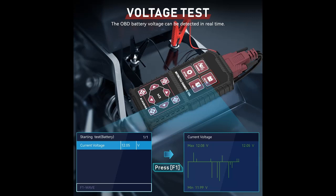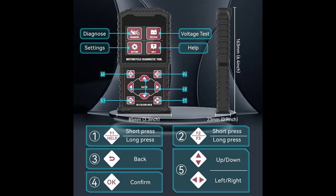Software Upgrade. Connect the device to the computer and wait for the device to be recognized. After recognition is successful, a new drive symbol will appear on the computer. Open this and replace the Diagnose folder in the drive with the downloaded Diagnose Upgrade folder, then power on again.